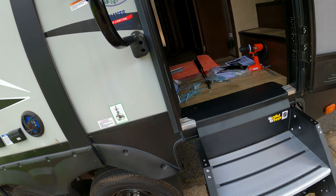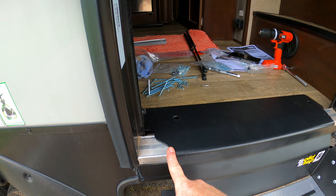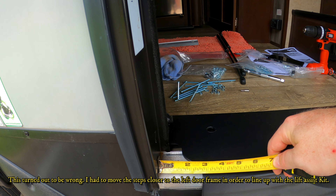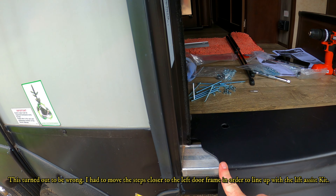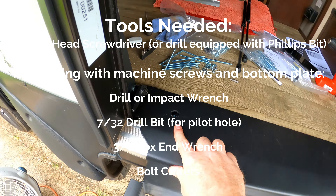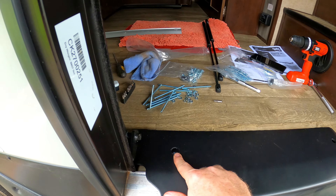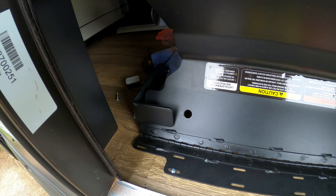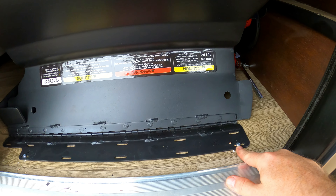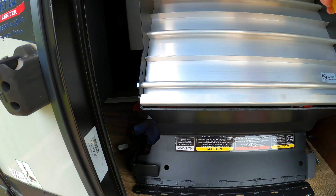The instructions call for the space from the left door frame to this surface to be two and five-eighths inches. You want to get it as close to that as possible — and we are right there at two and five-eighths, from this surface to this surface. Then what we did next was drill two pilot holes right here. You have these two caps that have been removed and there are holes right there that line up. Make sure to fold this piece under when you're drilling your pilot holes, and this piece will lay on top — so this is what you're drilling through when the steps are down.